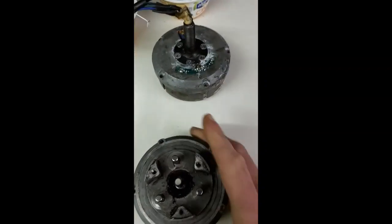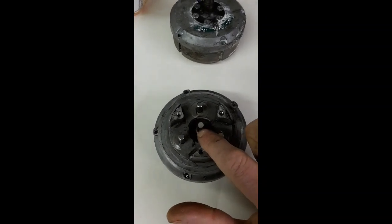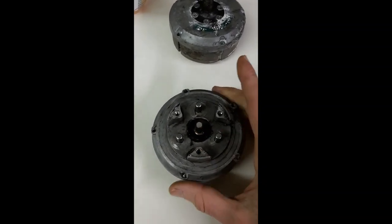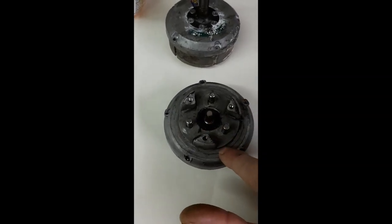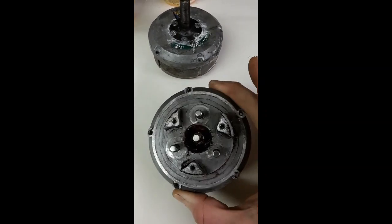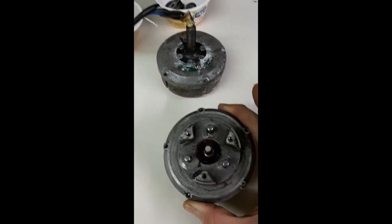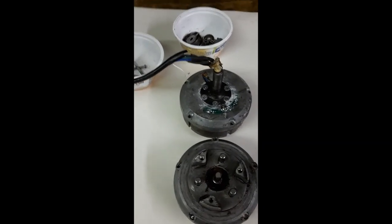It's a good fast motor — some sort of in-runner, because this is your drive centre pinion there. So it's an in-runner and you get a multiplier from this diameter to the clutch outer diameter via the three rollers. It's got a lot of torque — it's a high performance motor, better than the other hub motors I've had, and it's very very small and discreet which is handy.